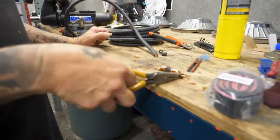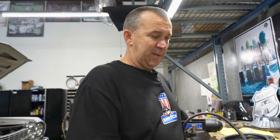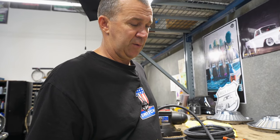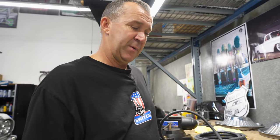These short ones are going to connect the batteries together. We have four batteries — we're going to connect them for the front pump to run 48 volts, and then I believe we're going to use two or three batteries for the rear, so we either go 24 or 36 volts, just to make it a little bit slower.